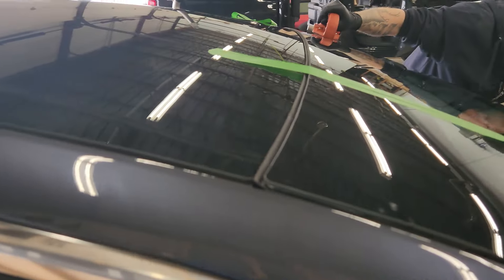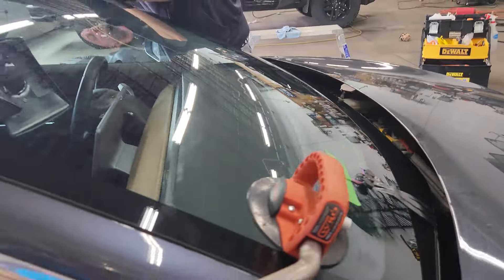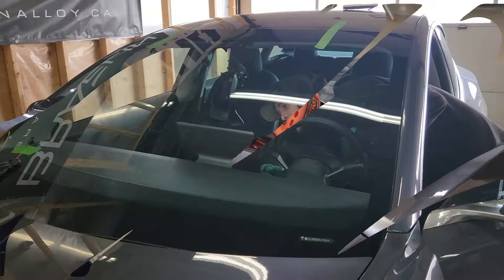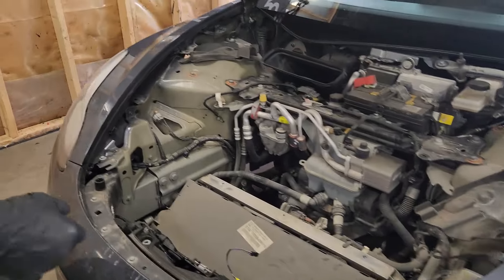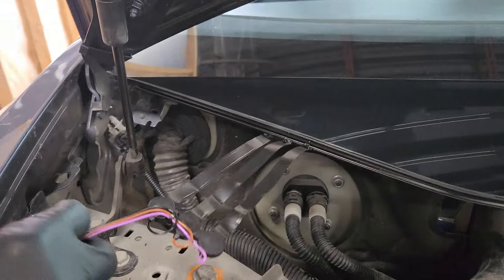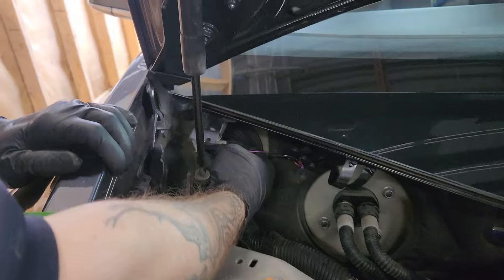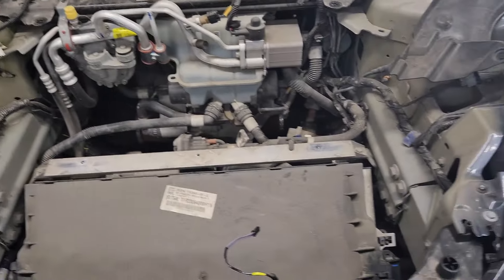Big problem averted — everything is good. The wire is where it needs to be temporarily and we'll plug it in once we get to that point. Windshield's in. Now the wire that Jeff forgot to tape up — that plugs in right there. That's your heated wiper park area. Then it clips in, and you're done. Then it's just a matter of putting all of this stuff back in again and cleaning it up.